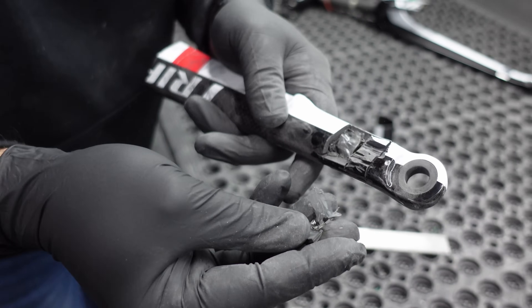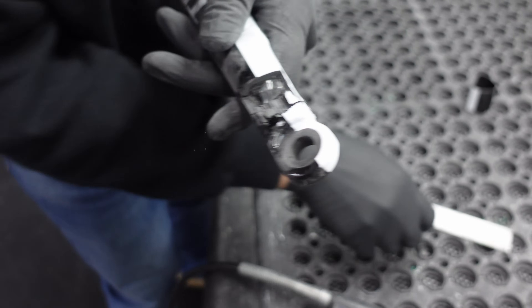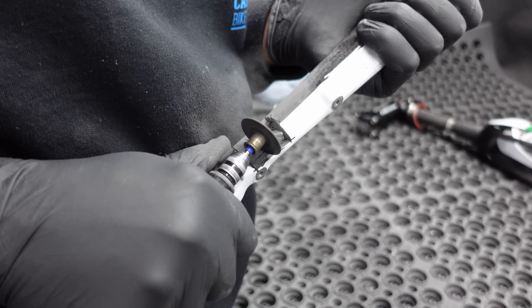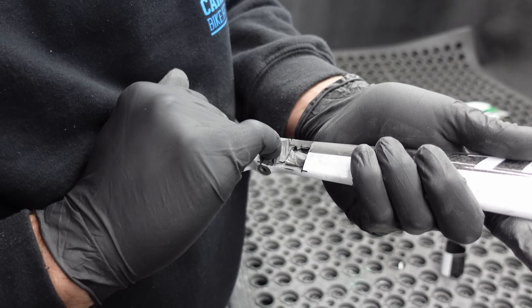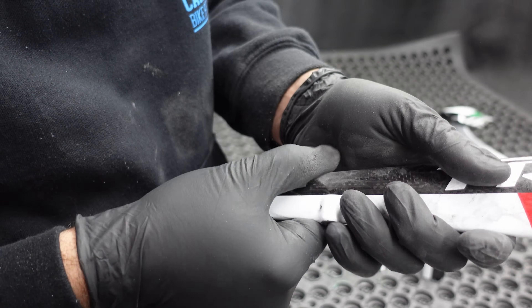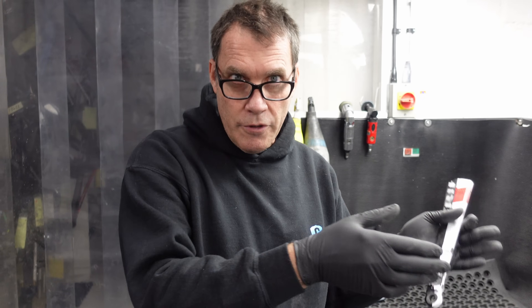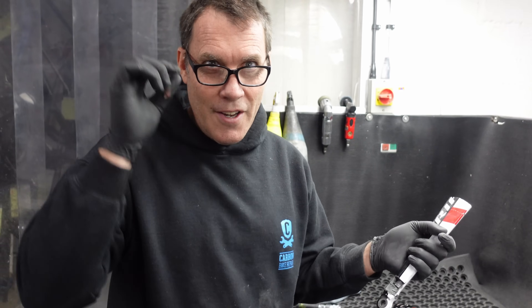This is the bladder that pushed air to the edge — that's what's left as a remnant. The fork is solid there and I don't see any signs of lugging, so this is all moulded in one piece. It seems to have utilized maybe an older mould, but typical of manufacturers who mould for the big brands, then integrate those processes into cheaper bikes — which in essence is good news for the cheaper end of the market.